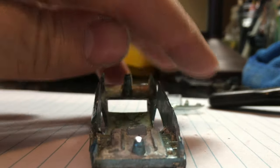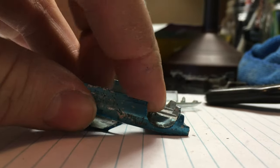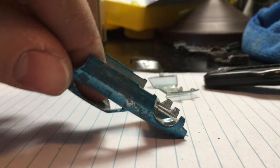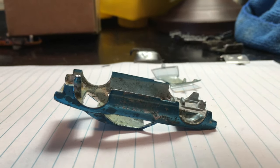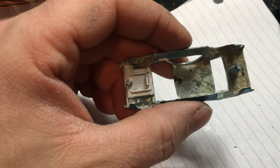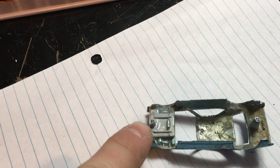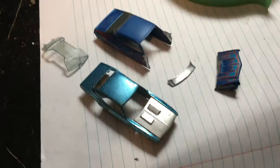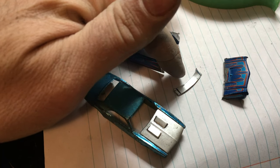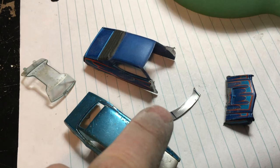The bent area was in the front, so I turned it upside down, held it slightly off the ground with the front nose touching, and very gently used a plastic knife tip to straighten it out. In order to mount the mushroom-headed rivets, you have to drill out the center of the post, which is exactly what I've done here. I have cut up the donor car and I have a cowl that I'm going to try and get to work — it still needs to be trimmed but the shape is very close.